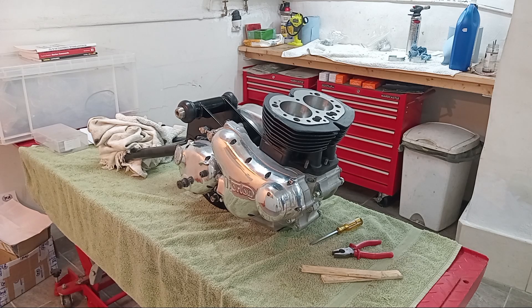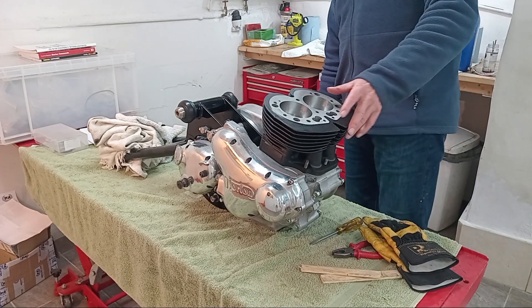I think that's gone well. It's always a little bit stressful, but it's so good to get the barrels on - it's just such a landmark. They look so good. I'll loosely get the nuts on, then we'll turn the engine over a bit and just check that everything's nice and smooth. It feels good at the moment. You can feel if there's something wrong with the rings, but I think we're fine.